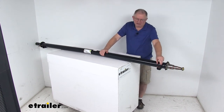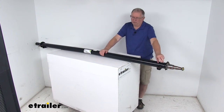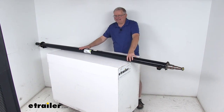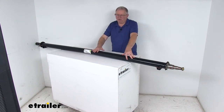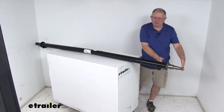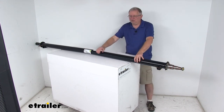If that label happens to be missing, just look at the wires that run through the axle for your electric brakes — these should also face the rear of the trailer. The electric brake wires are included if you're going to be installing electric brakes. Having the center ride a bit higher and the sides of the axle bent lower allows the axle to flex just enough to compensate for the load. This bend creates a nice zero camber angle for even road-to-tread contact across the width of your trailer tires, ensuring the wheel angles are correct for your towing needs.